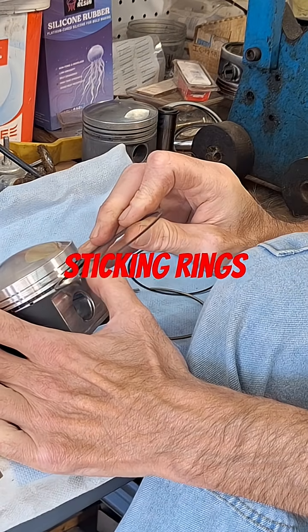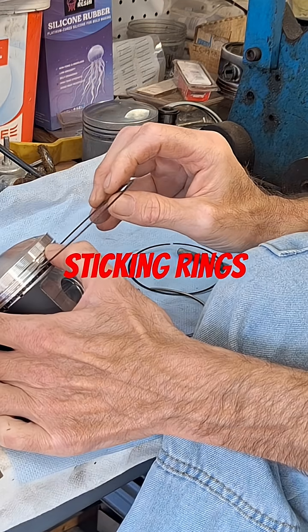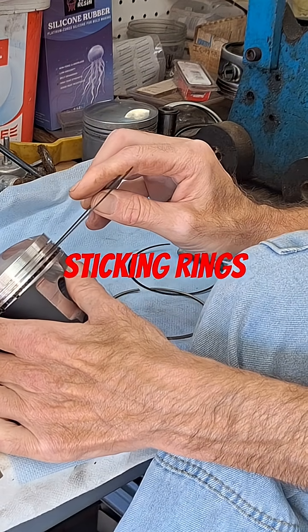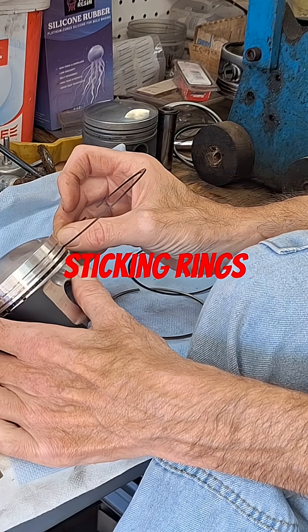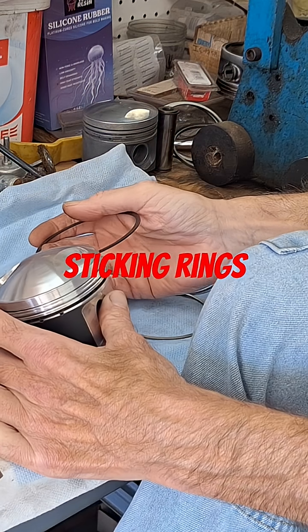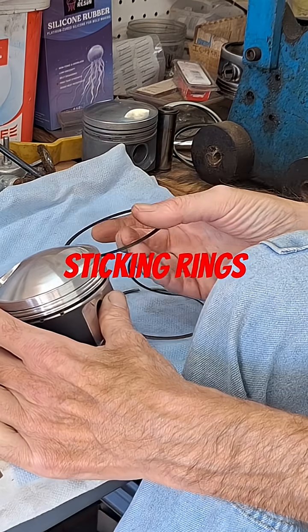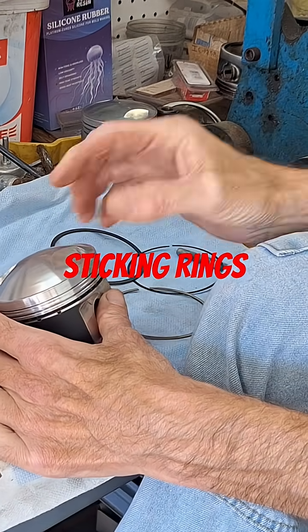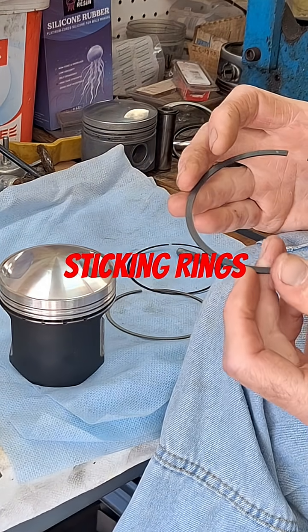For instance, if this was a used piston and you put your ring in there, you check your side clearance at a couple of places, but then you start rolling the ring around and you find that it's got a tight spot — say right here, or it could be anywhere, over on the other side. You've got a tight spot in there, meaning that the land has moved at some point, so it's kind of pinched together, which will stick the ring.